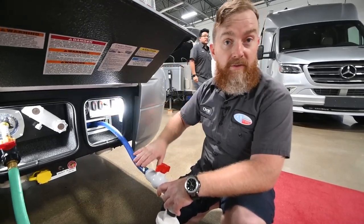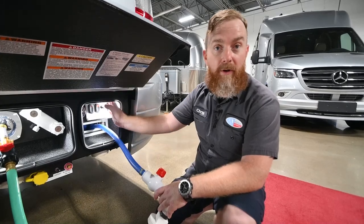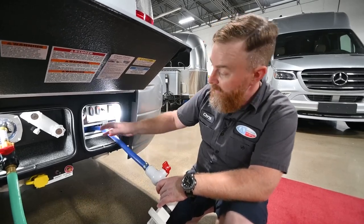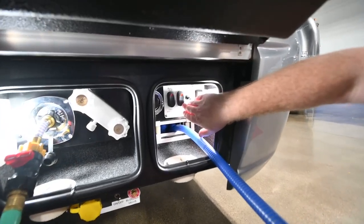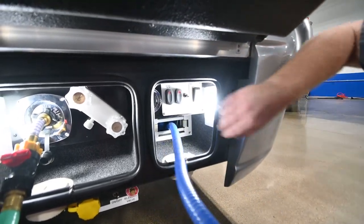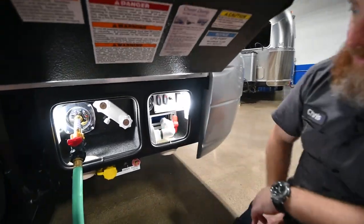Run the pump until you hear the pitch change to high pitch. Once it does, start looking at the hose. When you see the water start to chug through there, turn the pump off. You don't want to run the pump without water coming through it — over time that'll cause too much heat and make the pump fail. Then close the valve and retract the hose back inside the compartment. Make sure you wind it back and forth across that drum so it sits on there nice and flush.